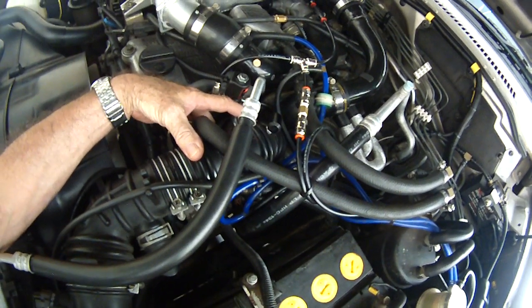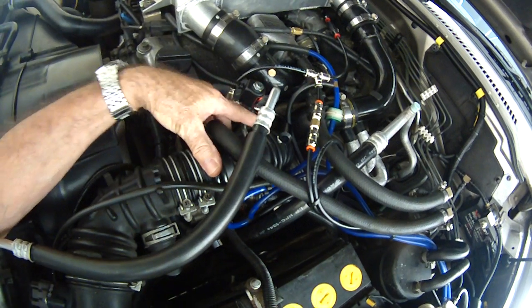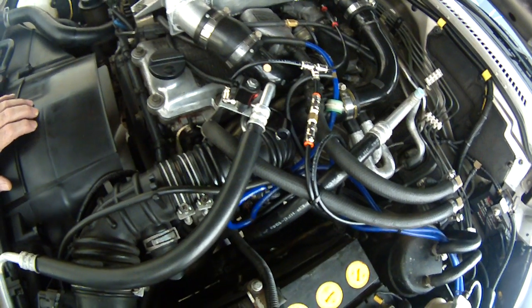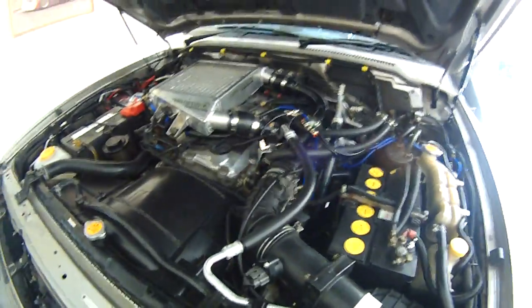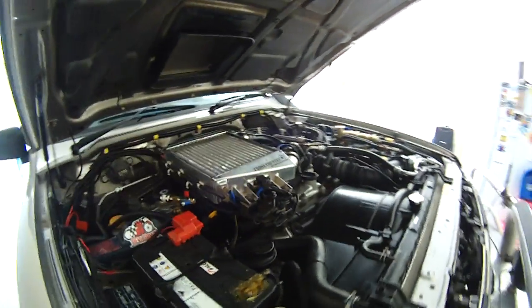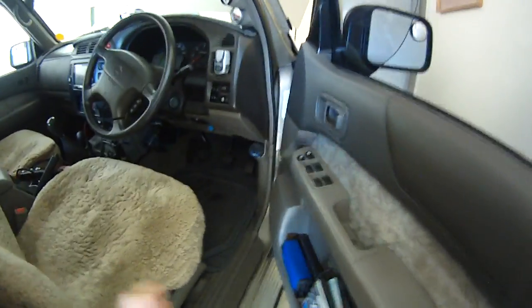This hose is a very firm rubber and it's quite solid. I've had three nozzles in here in the time that I've been experimenting — it handles it very, very well. So from there we'll go across into the cabin. Garrett actually recommend that you be within 150 to 250 millimetres away from the turbo rotor for pre-turbo injection.